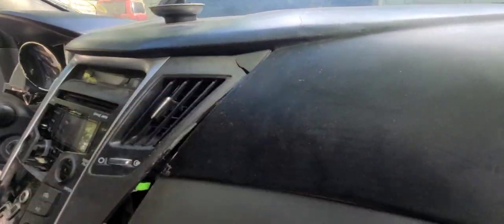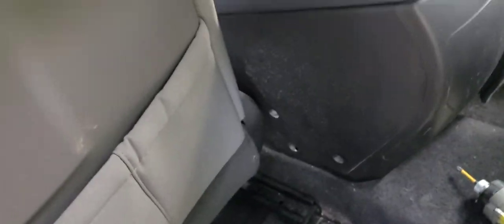Be careful when you're pulling stuff because I just broke a piece right here - we'll have to get another one at the junkyard. Taking the center console out first since it'll be easiest. Down here on the passenger side you have a cover that just comes out held by clips, and just one bolt that holds it in. On the driver side there are three bolts - one, two, three - and the same on the other side.